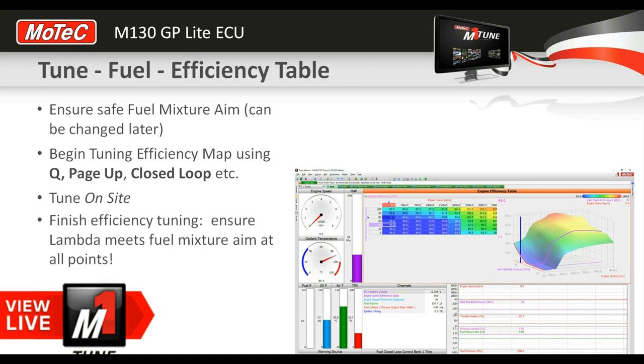So after we get the whole engine tuned nicely, we'll aim for some nice safe lambdas, then later on, once everything's sorted, car's going well, driver's happy, you can then start to lean the engine up, and simply by aiming for a different lambda in the fuel mixture aim table, that will lean out the engine appropriately. Okay, so we definitely want to start on the more conservative side, especially if we're just learning.